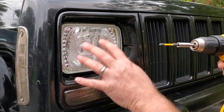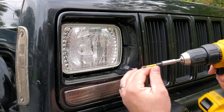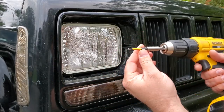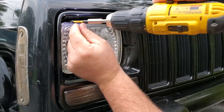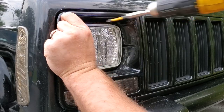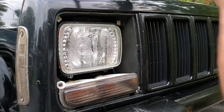Getting into this headlight is no biggie — we're just gonna take off this headlight door, done it a hundred times already. This bit helps — it's like a long extension for an impact driver and it gets in here nice and easy so you can reach these fasteners that are deep inside. It's just the top two and then the door comes right down.